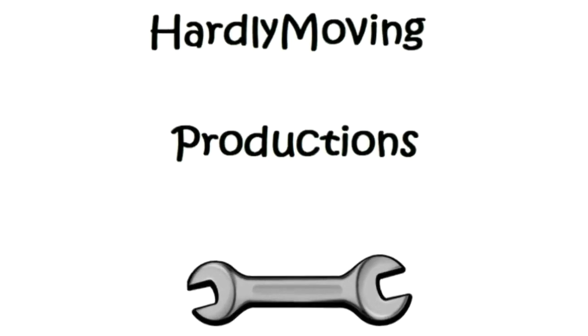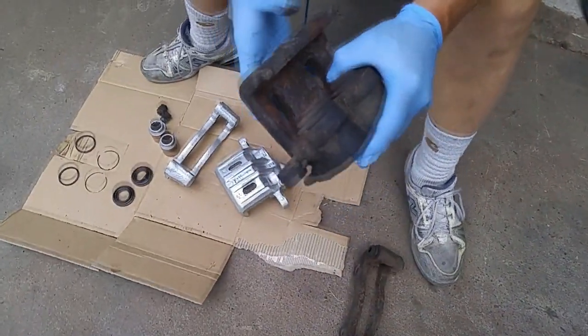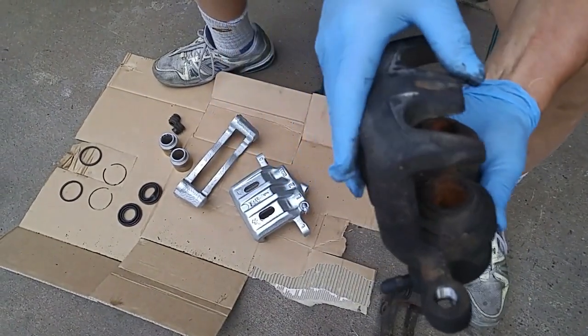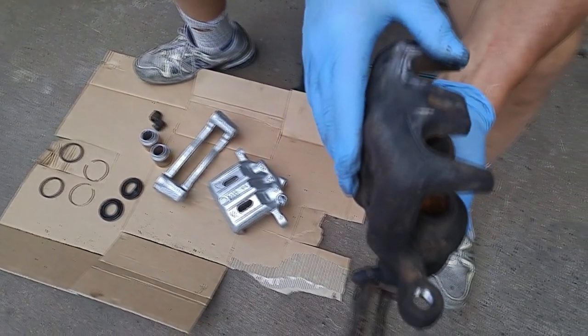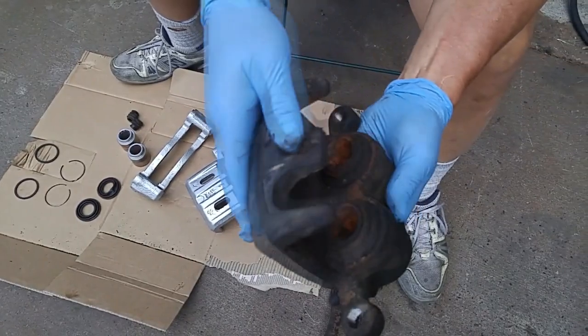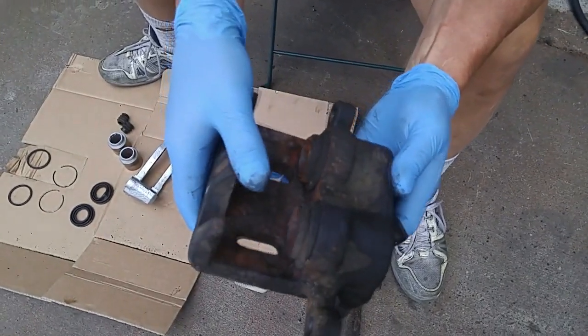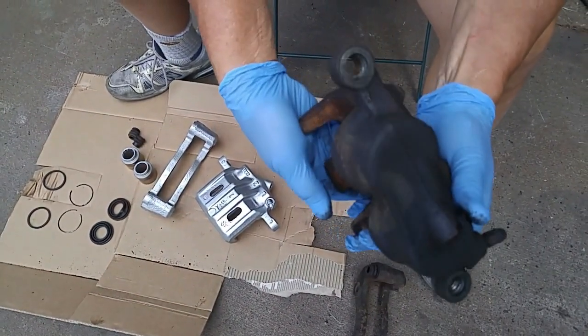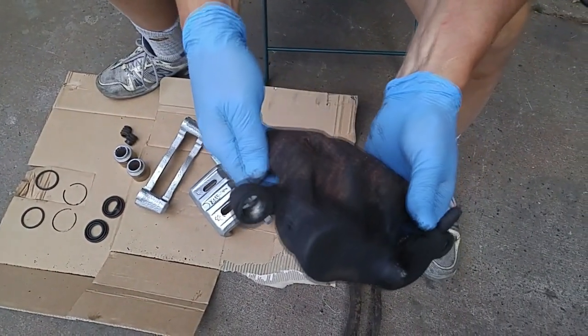So you're in the process of doing a brake pad replacement, and you're either having a hard time compressing the caliper piston back into the caliper, or you manage to get the pistons compressed in, but then the first time you put your foot down on the brake pedal, your wheels lock up. These are all symptoms of a caliper piston that has corrosion,